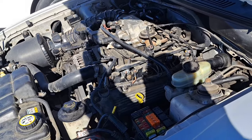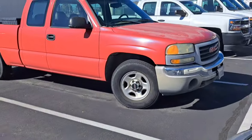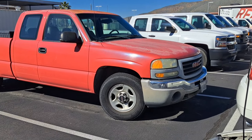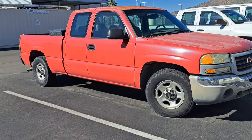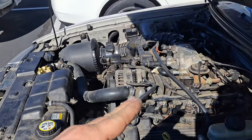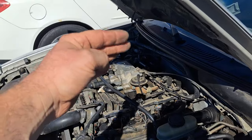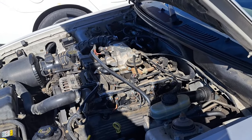There are other exceptions too. A heavy-duty gas-powered vehicle like a tow truck or an HD truck — say a GMC 2500 HD with a 6.0 or 6.2 — is a good candidate for hydro boost. At idle you make good vacuum, but near wide open throttle the throttle plates open and the engine can pull as much air as it wants, so there's not a lot of suction. Heavy-duty vehicles working hard under load are often better served by hydro boost even if they're gas-powered.